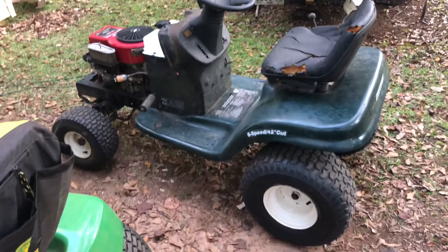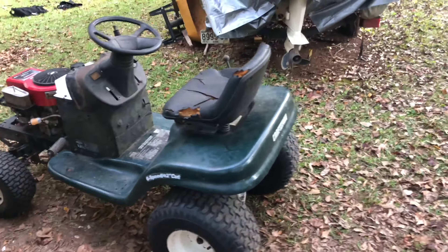Someone called it the Slim Mobile — Slim Pickens. The Slim literally went from a pile of garbage sitting outside to a halfway running lawnmower. It still needs more work, but it has potential and is worth continuing. It's definitely a drag cart. I'm probably just going to do what Cars and Cameras did — cut that off, weld something right here, weld the spindle on, and belt the wheel on. Then the rear end, just cut some part of it out and move it up, then add a jackshaft with a bigger pulley to increase top speed even more.